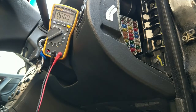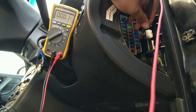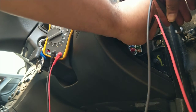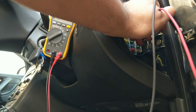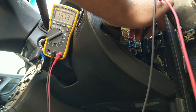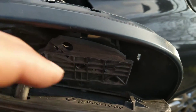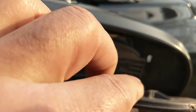On the lower of the white fuses I'm doing a simple voltage test, using the door bracket as a ground, with one probe touching a pin on the fuse. I'm getting battery voltage, so even though no current is flowing for the mirror, voltage is available at the fuse.